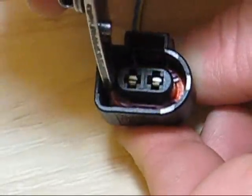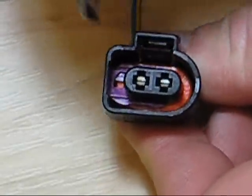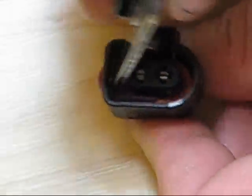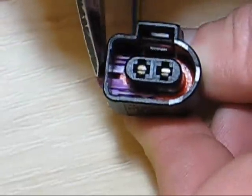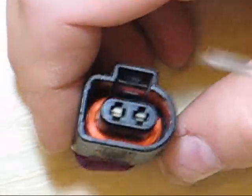The first thing you need to do is remove the secondary barrier. If you slide it over to the release position you can remove the terminals, but in this video I'll go ahead and remove it completely. You can see the secondary barrier is a horseshoe-shaped clip, so I'm now able to try to release the terminals.